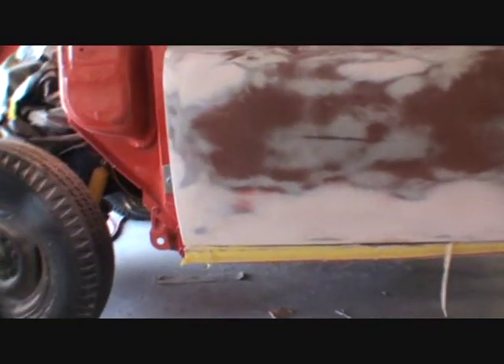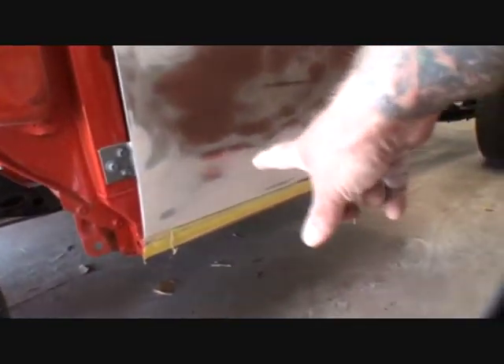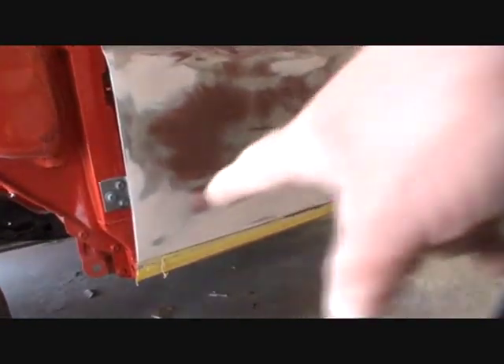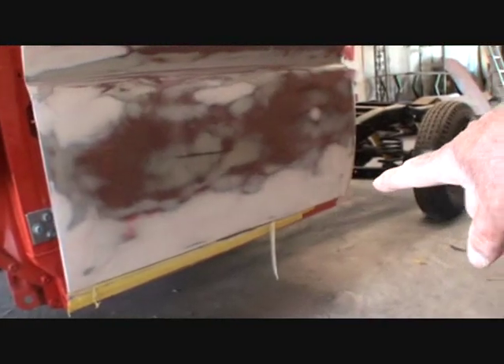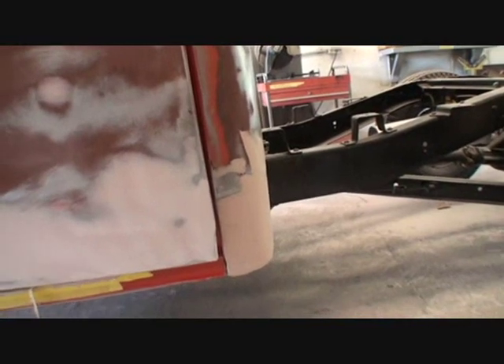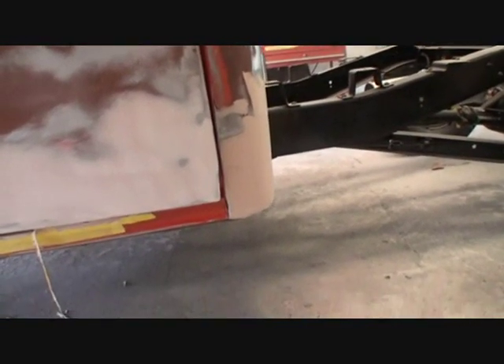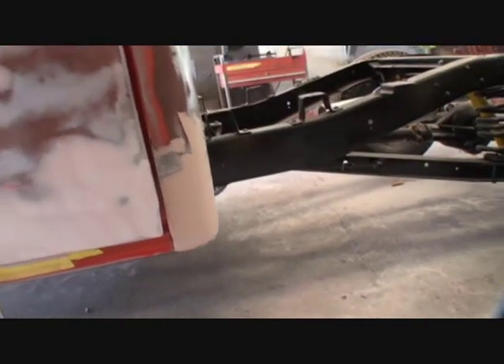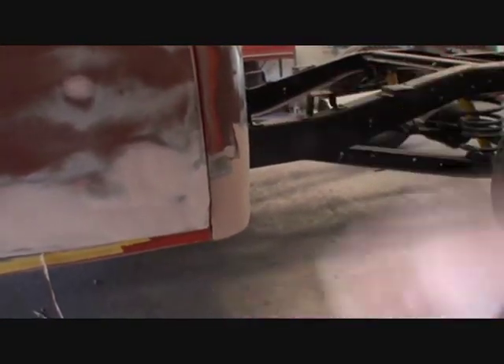You can see down here — when the owner brought the truck to me, what happened down here was they were loading it off the trailer. The trailer had side rails on it, and when they were loading it off, the side of the trailer caught our door and also caught the cab corner right there. That was crushed in completely beyond recognition. I went ahead and pulled that out with my slide hammer, then welded it all back together and fixed it up. So I saved the owner a bunch of money. We still got to finish block-sanding that — that's the last coat of Evercoat polyester filler on there.